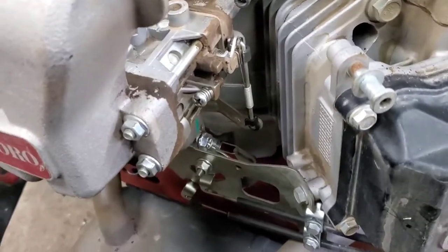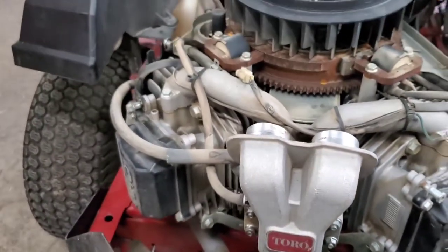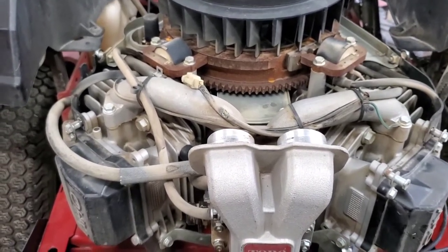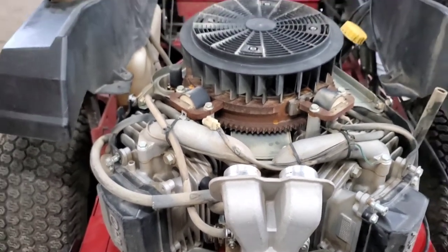Let's see if I can zoom you in a little closer. You can probably see there's some little jelly pieces. And if you look right there, see the water? That's still there. The gas evaporated. There was another spot somewhere — yep, see right there? When you see that water, that tells you you need to drain the carburetor, flush the fuel system, replace the fuel filter, and drain that fuel tank and get all that water out of there. And I'll show you how to do that.